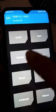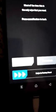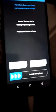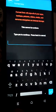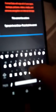Now first of all we have to wipe — this is a very important step. If you do not wipe your data, your mobile will soft brick or hard brick. So first of all, click on Format Data. Note that Format Data will wipe all your apps, backups, and internal storage.